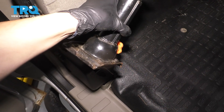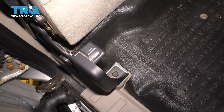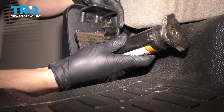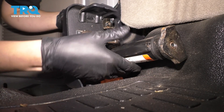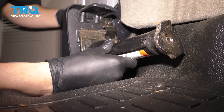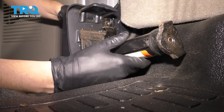To put this back, make sure you face the orange knob down, and you'll see that the jack has a little hook there on the outer lip — it does not on this side. You want to put that hook underneath the threads of this knob. That's basically what locks it in. This tab has to slide over the hook, just like so, and tighten it down. Make sure you lift it up off the ground a little bit so that when it's tightened, it sits on these rubber pads, not on the floor. That way it doesn't rattle around as you drive. Make sure you tighten it up nice and tight — you don't want it to rattle on you.